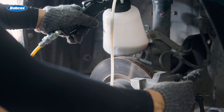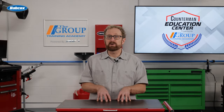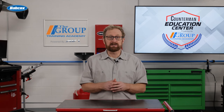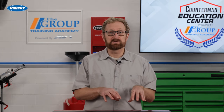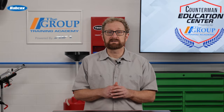Another sales opportunity is a drain pan to catch the brake fluid as it drips out of the caliper or wheel cylinder. Bleeder screws are located at the high point of a brake caliper, but it's possible to install some calipers on the wrong side. This is a very common mistake, and when it happens, the bleeder screws will be on the bottom. Your customers should keep in mind it's impossible to bleed the system like this.